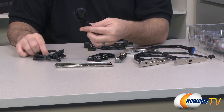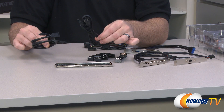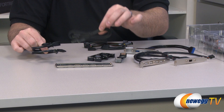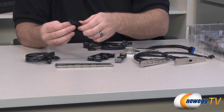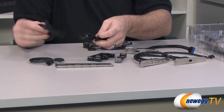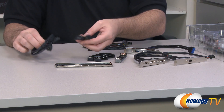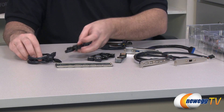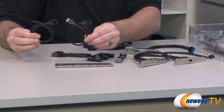Finally, you get some Serial ATA cables — four in total. They all have straight plugs. These should be Serial ATA Rev 2 and these should be Serial ATA Rev 3. These have clasps on one side but not the other; these have clasps on both sides. In most cases a SATA Rev 2 cable will work just fine for SATA Rev 3. I should also point out these are flat cables and these are rounded.